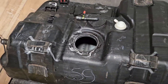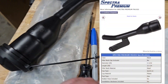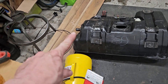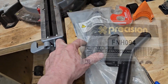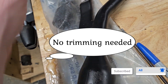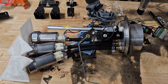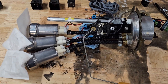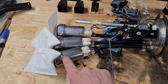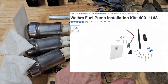I made a post about this earlier, but I picked up a 4th gen tank from Rock Auto. I got the filler neck, then measured the OD of the filler neck and on the tank, and came up with a part from O'Reilly's for a filler neck that matches both of those. I'll just trim it to size when the time comes. The only thing left was the sending unit. I was cruising Facebook, saw a post on F-body Empire — triple in-tank 525 pump setup. So I got three service kits with the filter and the PTFE hose.